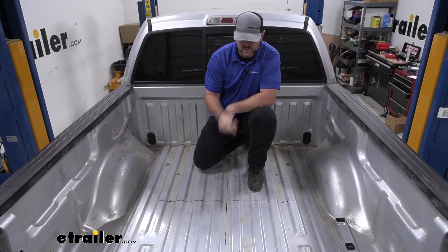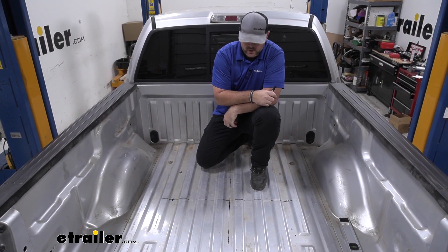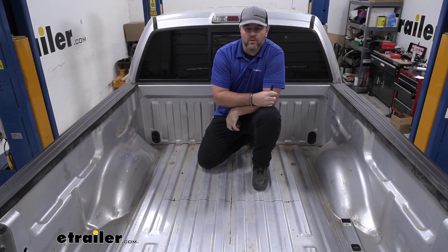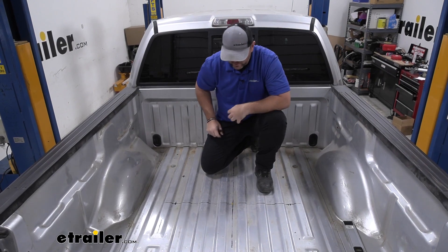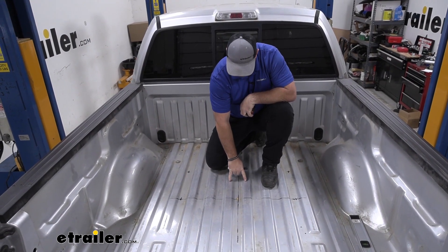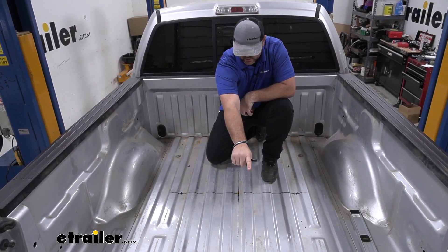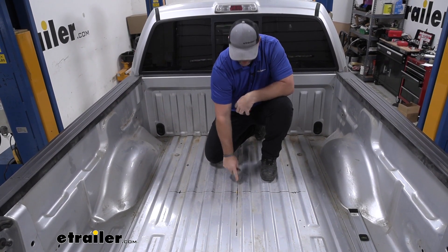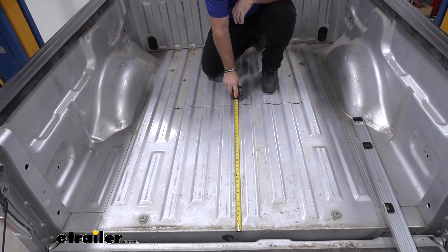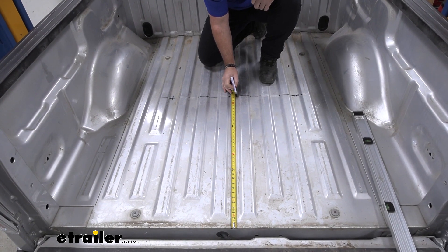To start our installation, we need to start in the bed of the truck — you can see I already have some marks here. The directions I will say are a little hard to follow, so I want to try to figure out an easier way for you at home to do it. What I found was we're going to make three marks right off the bat. We're going to find the center of the bed — normally you find the center, you're going to have two raised corrugations here that run down to the center. We're going to get into this lower one. We're going to go from the edge of the bed — not the tailgate, the edge of the bed — and we're going to come up 34 and a half inches, and we're going to put a mark here and a mark on this side.